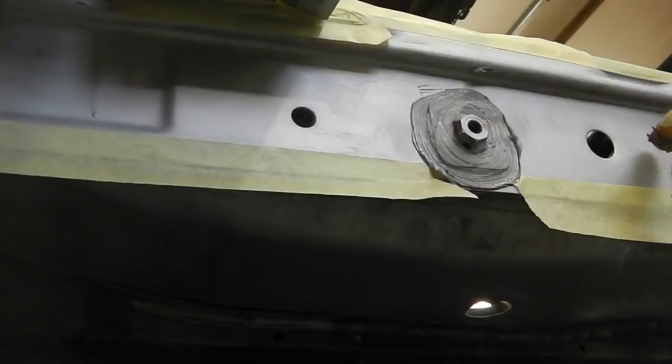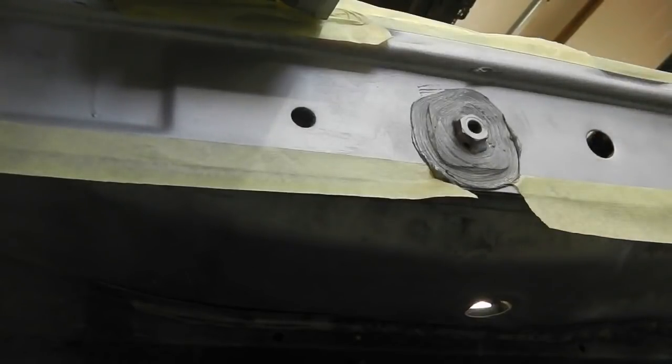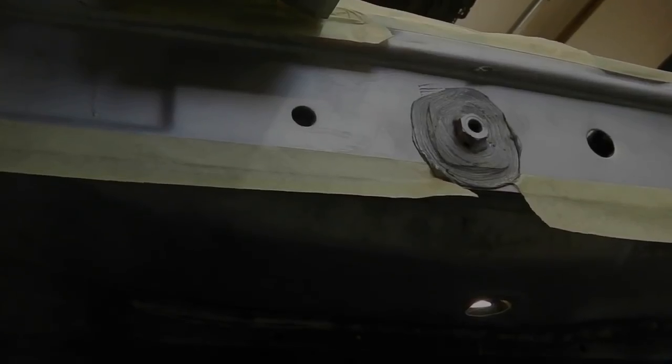There's an etch, there's a zinc, there's a weld through, then there's an over weld through. I think the original Ford paint's taken off, and then the zinc weld through primer on where the Ford brown was taken off. And now we're going to mask, as you can see, and then we put our colour coded primer on, just so that if you were to look through there, it looks nice and clean. We'll do that next. Paint I'm going on next, get a mix on.